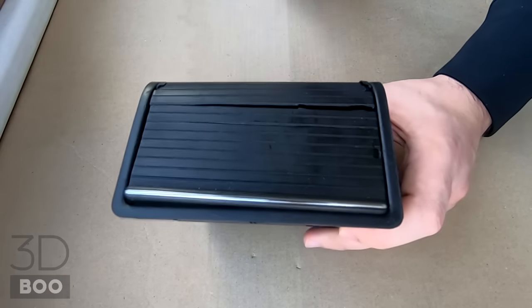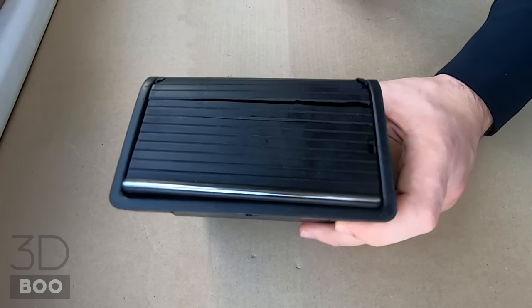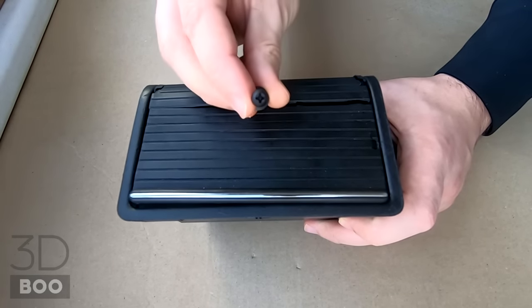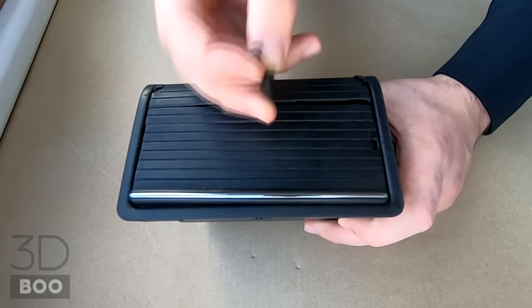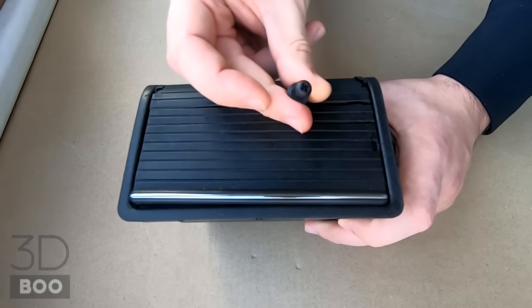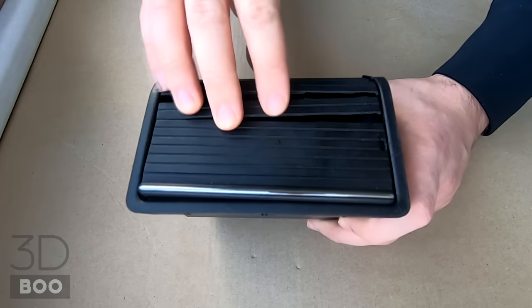If you're actually still in the car, you need a Phillips screwdriver. There are two plastic screws at the bottom of the ashtray — just remove these two plastic screws. Replacement of the roller is very simple.